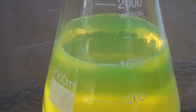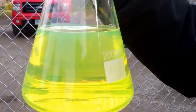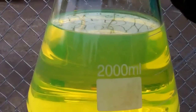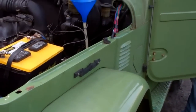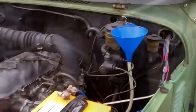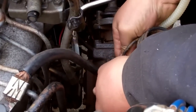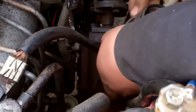You can see that blends pretty well. Doug Struble is currently holding the blended product — we have about 1,600 milliliters. We're going to pour some of that into the funnel and see what happens. We'll put the funnel in line to pour the blended product straight in. We just shut the engine off running on straight diesel and we're going to switch to the blend.